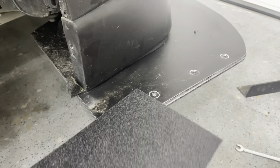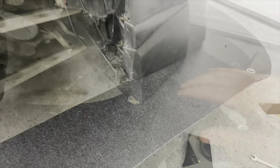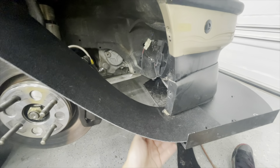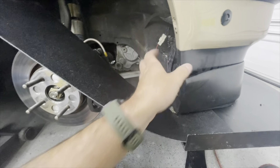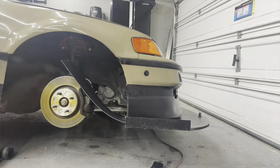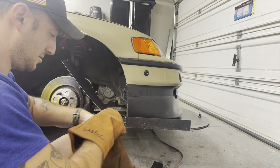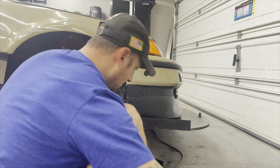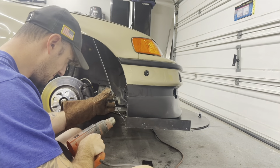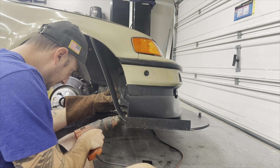In case you're curious, that's the old molding from when I wrecked the car. I've got another one in the shed — I just don't want to put it on yet since it was bulging out and touching the fender, so I ripped it off at the track. Super dirty — can't even see the Honda sticker. I do have foam underneath here to catch any extra gaps. I'm going to have to roughly get where this goes to match the other side and use the heat gun. This ABS does bend but won't stay, so the heat gun works fantastic.